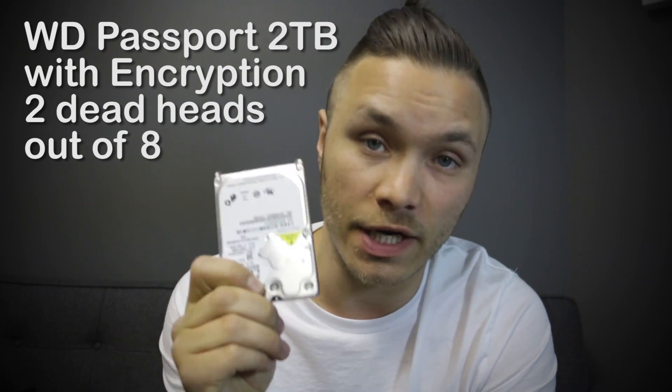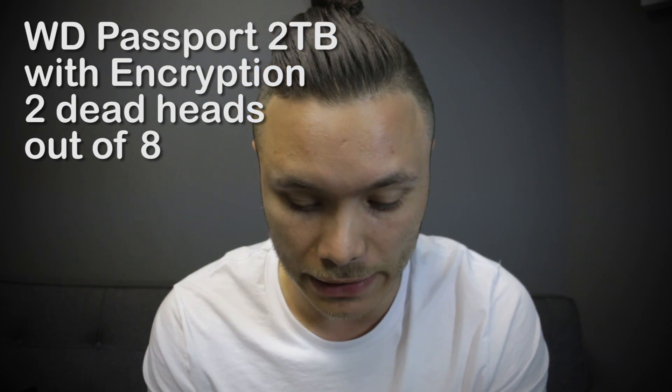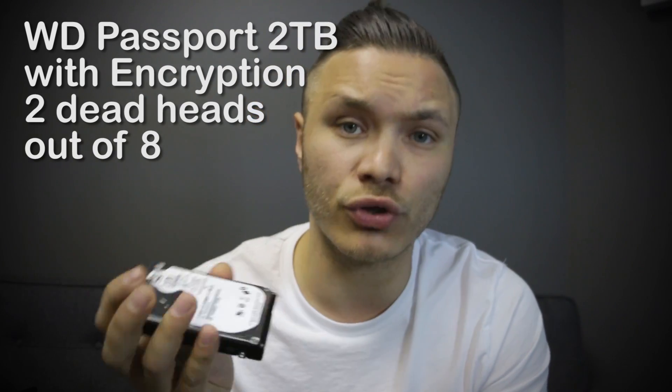This device is not fresh — we've been working on this for a little bit. The majority of these Passport drives that we receive come in for two issues. Number one is a slow response, which is like an epidemic for Western Digital products right now. Slow response comes on for a variety of different reasons, but the main reason is the device starts to get degrading heads. Degrading heads read information slower, the drive interprets it as encountering a lot of bad sectors, and shortly after the ReloList gets too many entries in it and the drive breaks.